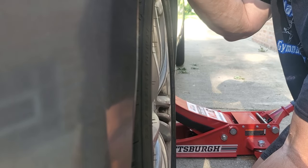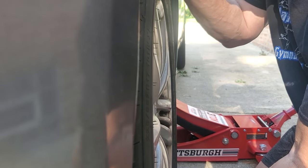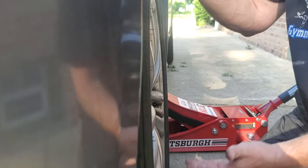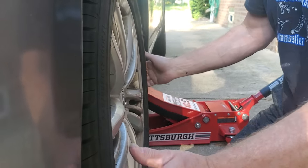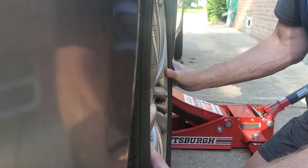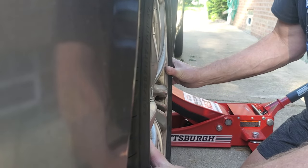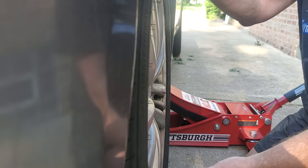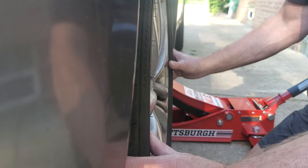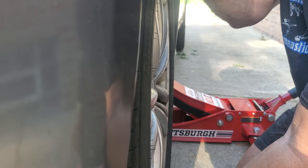So I'm just grabbing it at 12 and 6, rocking it back and forth. Can you hear that? So what's happening is I'm driving the car and that little bit of movement that you have here — it's like boom, you really feel it. It's like what the heck, something's wrong. And then you go 9 and 3 with your finger on the inside of the wheel here and you do the same thing. There is some movement there — movement this way as well as this way. Both ways are tests for a wheel bearing. The 9 and 3 position is testing for a tie rod as well, and the 12 and 6 is testing for a ball joint.